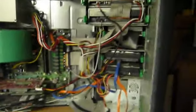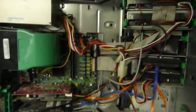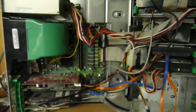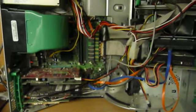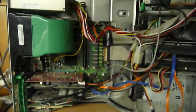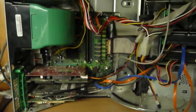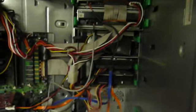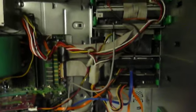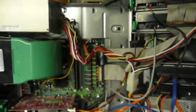The other thing that has dissatisfied me so about this system is no matter the processor, this thing has never felt particularly zippy because it's always had a bad time about getting disk I/O bound, sometimes so badly that you couldn't regain control of it. I don't know if the motherboard's not quite right, I don't know if it's just these older hard drives that are holding me up, but I'd have expected that problem to alleviate itself when I installed the new Seagate drive, and it didn't. So I'm not sure what's going on there.